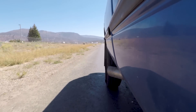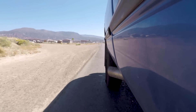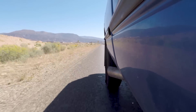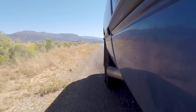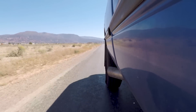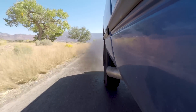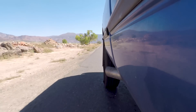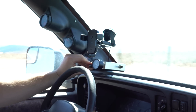There was no smoke that time, but it was a little lethargic, so we're going to give it some mid-range back by adjusting the fuel rate. Still a little lazy — let's try a little more. That one had just a little bit of haze, which is personally where I like it; your taste may vary. That was getting a little past haze and back into what I'd call smoke, so we'll back it down just a hair. The other problem with where we had the fuel initially set was too much smoke on the top end, which is what the power knob addresses — so we'll dial the power knob back just a little bit.